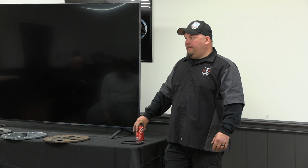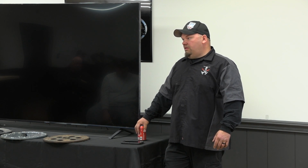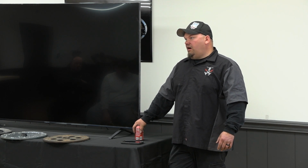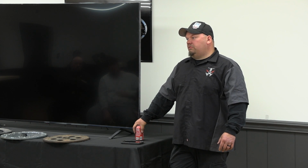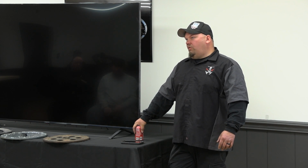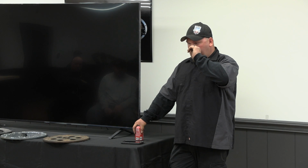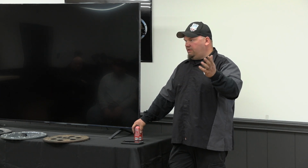Harnesses, yes. You can just run factory harness, delete what you don't need, tune it out with HP Tuners. Some guys do. I tune with EFI Live, and our harnesses are 100% brand new, made from scratch. There's a lot of companies out there that'll weed a harness for a couple hundred dollars, and I'm not stopping anybody from doing that. I can't base my business off of a 20-year-old harness that may have gotten yanked at the yard, have a green connection, or so on. When I hand you a harness, I need to know it's good, to take that doubt out of it. Well, maybe it's a bad ground, maybe it's this, maybe it's that, I can't do that.